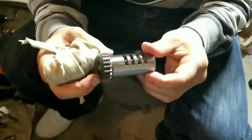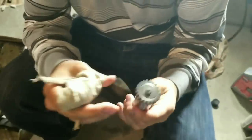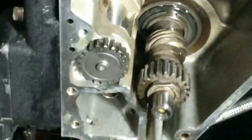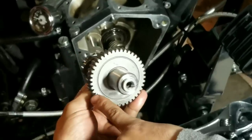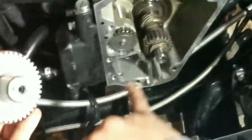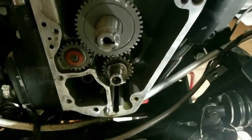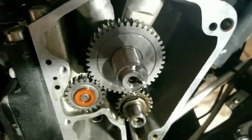Here is the aftermarket breather valve from Ultima — it beats the plastic one that's in the Harley, definitely. Going to get the cam in — notice the two timing points: this one will be timed to the valve and this will be the pinion. The cam, breather valve, and pinion gear are all lined up. The thrust washer and the shim are also on the cam.